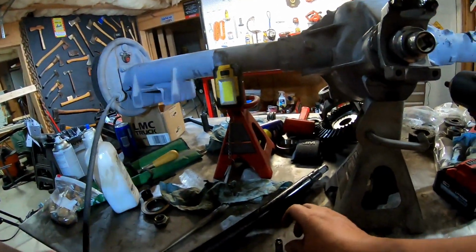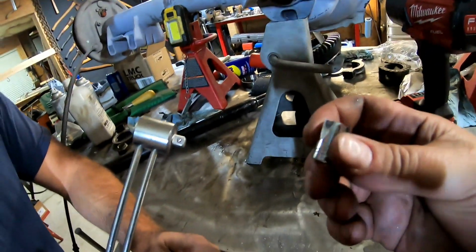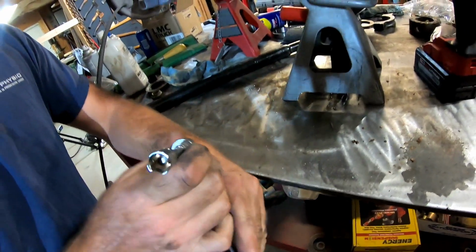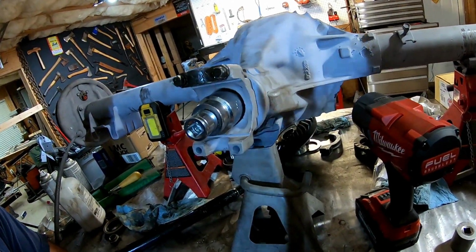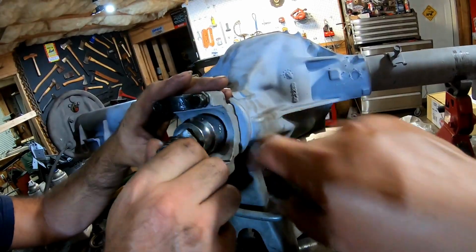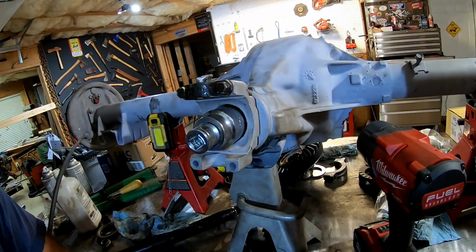You want to show them how we had to make this? We sacrificed a 10 millimeter socket and ground it down on the ends. We had to go to a quarter inch, then we took a 10 millimeter just to square it up to get it into a half-inch drive, because I didn't have a reducer like that. Plus this is 1 inch and 5/16, and this goes 1 3/4, and this is three-quarter socket. So we've had to do some finagling and some engineering to get this to work. We're going to hit this thing one more time, and hopefully we'll get it to 16.